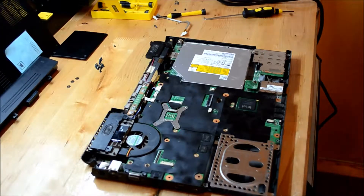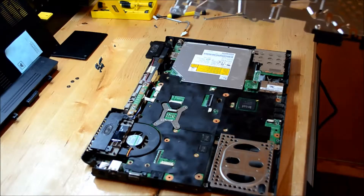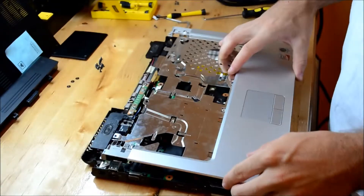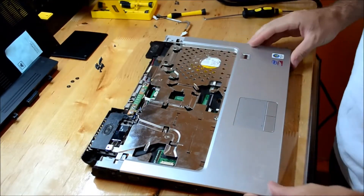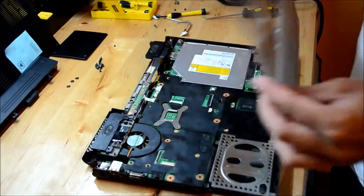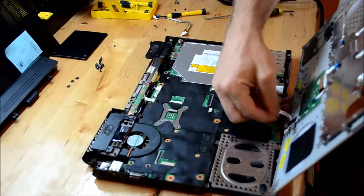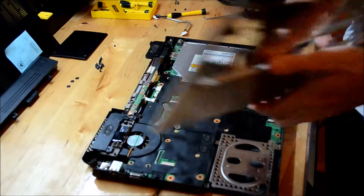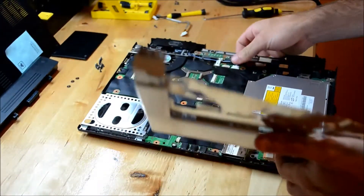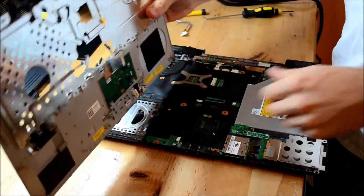Once you've got the base with the speakers installed, the next thing you're going to need is the palm rest. I've gone ahead and repaired this. The palm rest just sits in here like this, but remember that you've got to connect one, two, and the third one under here. The easiest way to install this one — you can kind of see if you can get it like that, but what I do is actually turn it this way to get it installed.